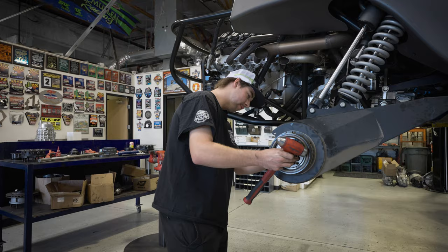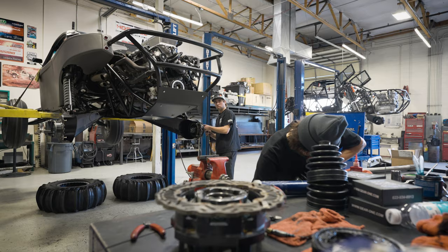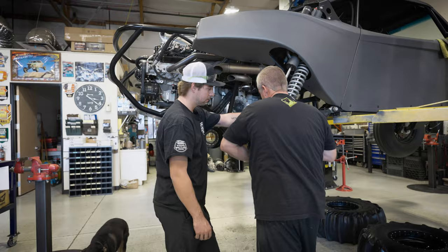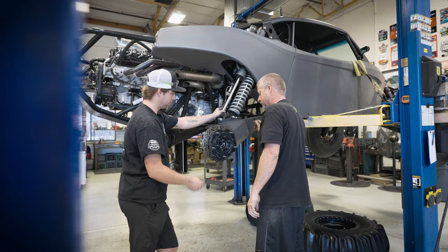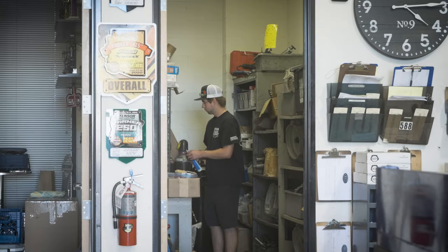Boom. See, that's one good thing with gear one. Perfect. Grease it? Yeah. I greased both bearings and everything else. For this one you've got to do the CV and then the seal — hammer the seal in and then set your set screws on. Set the CV in the center and then you can put your hub through and all that stuff.